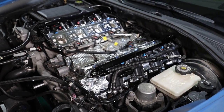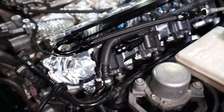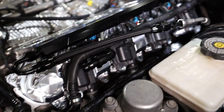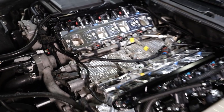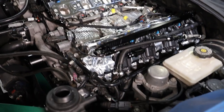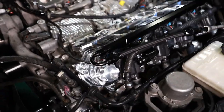With that, we're pretty well wrapped up — time to get the blower back on. We do have new billet covers for the Magnuson or any engine using port injection. With these valve covers you'll be able to run the LP or R plates on any engine application. The coils are moved down and out of the way in the right location, and there's plenty of clearance for the fuel injector down in there.